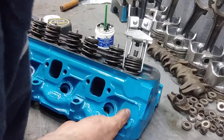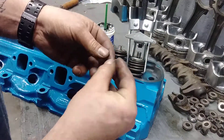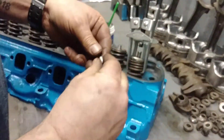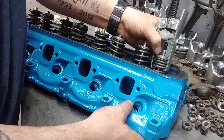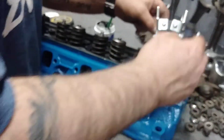Now the valve came down here, so I'm just going to push it up. Now you've got these two valve stem retainers. They go like this — there's a notch right here on the valve. So you just insert them. It's a little bit tricky — the first ones are tricky but after that you get the hang of it. Oh man, I dropped it. Alright, let me start this again. I'm going to get a magnetized screwdriver here, that will help to get it out.